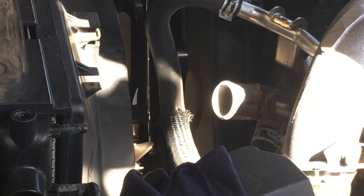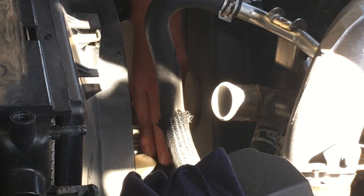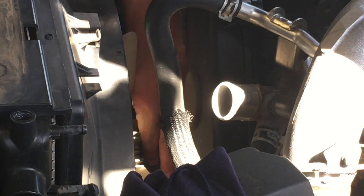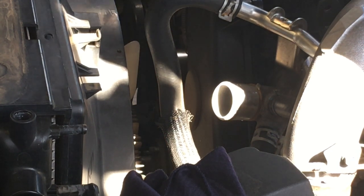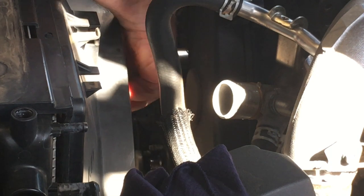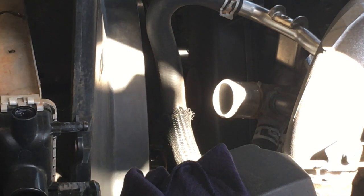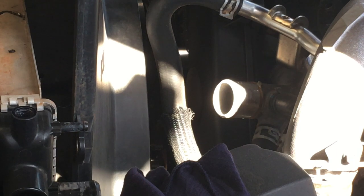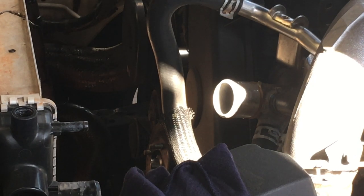Last nut to go — a bit of a kick on the spanner and it came undone. It can be harder if the fan cracks loose from the hub. At the moment the drive belt's still on so the fan is hard on the water pump; all the nuts are off. Now the fan's off and will lift out together. I'll take the fan itself out separately — no point making the job harder lifting them both out at once.